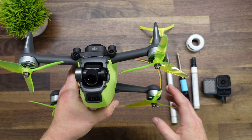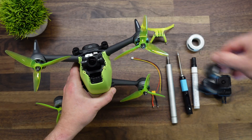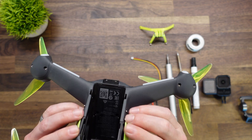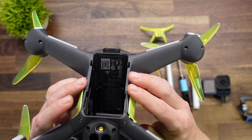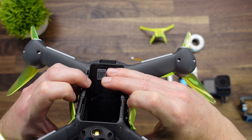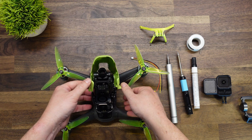After we remove those eight screws, we need to remove this plastic portion — it will just pop right off, just like that. Then we need to remove the canopy itself. I've already popped these out; basically just use something plastic to pry them out. Once you do that, all these little pins will come unclicking, and there goes your canopy.